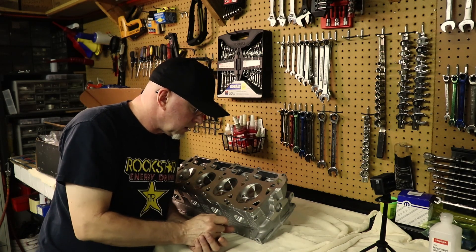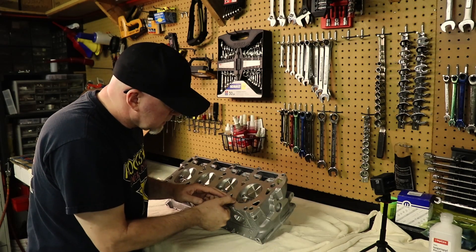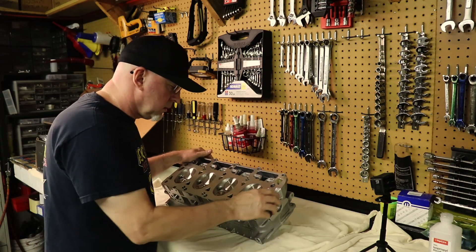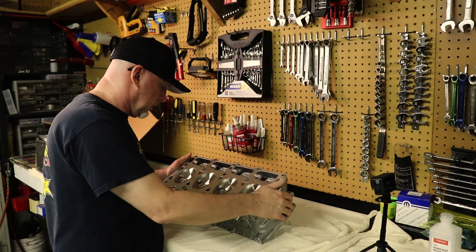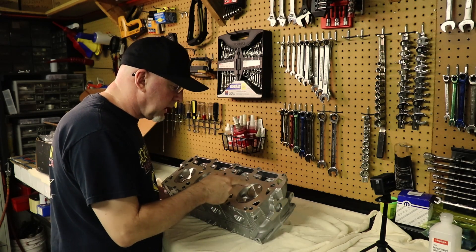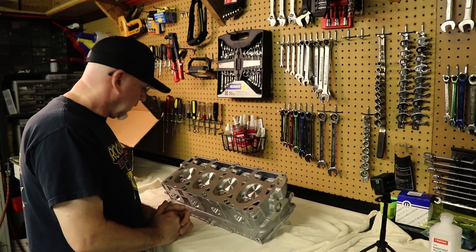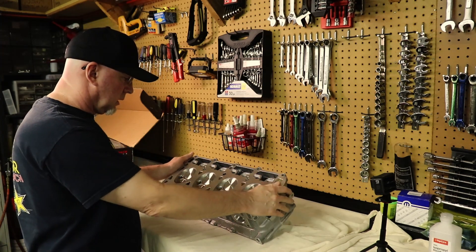That exhaust valve is shrouded a lot. If you look at their picture, they just kind of rounded that out and took the shrouding away - that could be done by hand. What do you mean by hand blending if you're not going to touch it and didn't do anything to it? That's rather disappointing. The factory casting is actually very smooth, but if they would have just taken this sharp edge off and unshrouded the valves, I would be a pretty happy customer. As it is, they didn't touch it and I'm disappointed. Compared to their pictures, there's a night and day difference - this looks like it's only 90% finished.